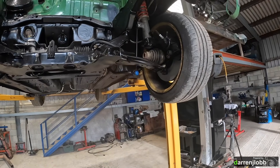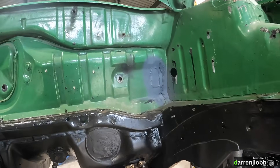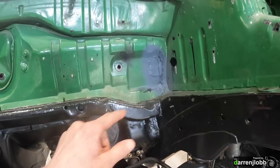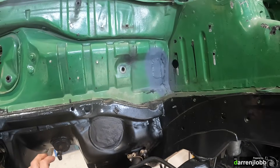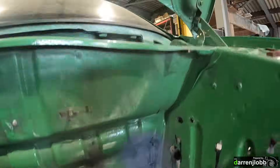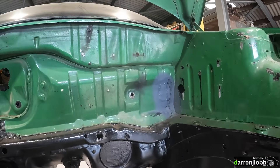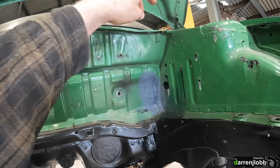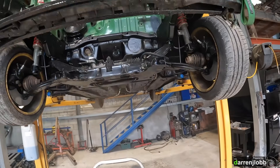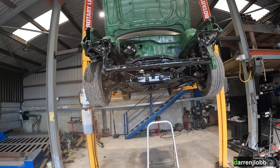There are just a couple of other things I wanted to include - I wanted to weld a patch on the bulkhead. There was a load of cables and pipes needing to get from the engine bay to inside the car, and there was just a hole there that got bigger and bigger - always a complete lash-up I was never happy with. So I've completely done away with that, welded it over, and also welded a patch plate over where I had those bulkhead connectors. I was never happy with them being up there - it's under the scuttle panel from the windscreen, all the water ends up down in there, and although I never had a problem I could easily see that becoming a problem one day. So I've welded over that and we're going to move that elsewhere on the rebuild.